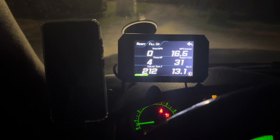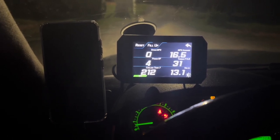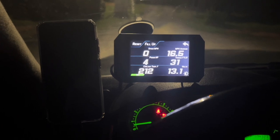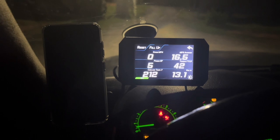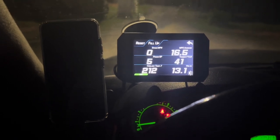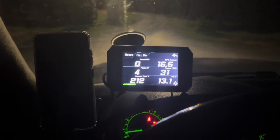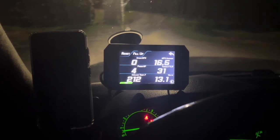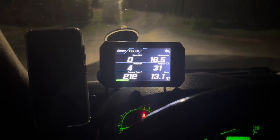And what I ended up doing is, I did actually pressurize my system. I did not put vacuum on it, but I just put pressure on it to test it, to see how much PSI it will hold. I basically let it hold at 15 PSI, and it would sit there for about 18 minutes and lose about 2 to 3 PSI in that time. And I was keeping track of everything.